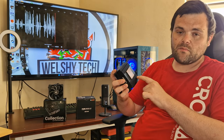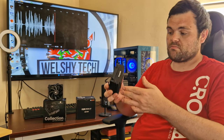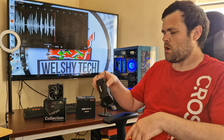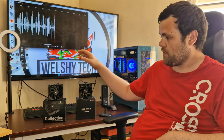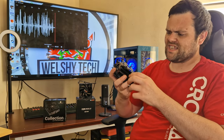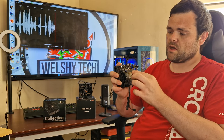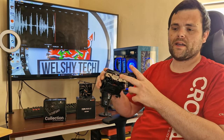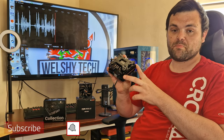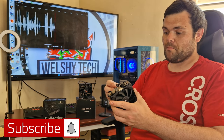Now of course this one by Be Quiet is just fins. It does look like it's got a heat pipe inside, and then it's just got a copper plate. That is minimal, just basic design, but of good quality, as Be Quiet is known for. The one from Thermalright is bigger, thicker, with a bigger base for the CPU. It's got big heat pipes, and the fin density as well as the fin stack itself is bigger. Overall bigger, and of course this one's going to perform better.